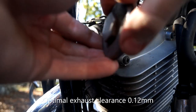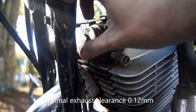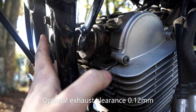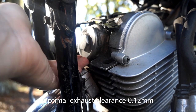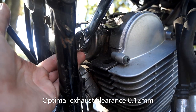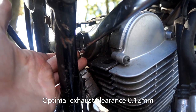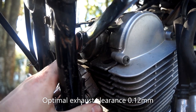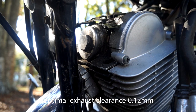We're good with this exhaust valve on this cylinder. We're going to go ahead and get our cap in place and tighten it down — that's one done, three to go. I'll do the intake valve on the other side of this head in terms of getting the adjustment in spec but I won't show the full process again as that would get tedious. The cap is aluminum so just get it snug — don't go wrenching on it — and then I'll readjust the camera for the intake side on the other side of the bike.